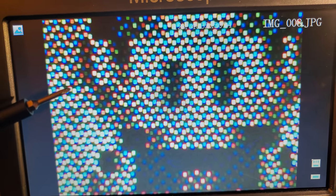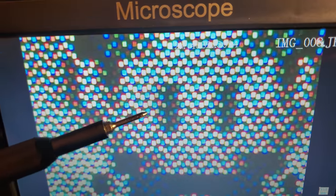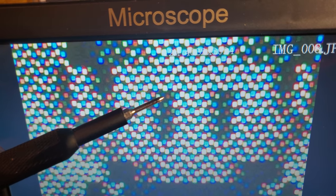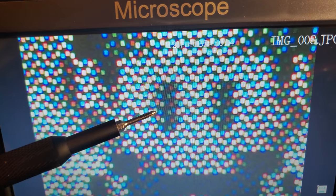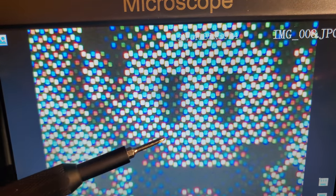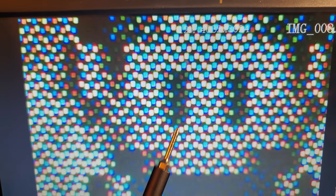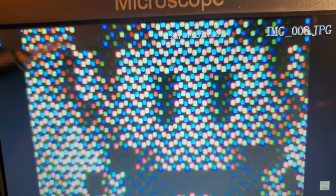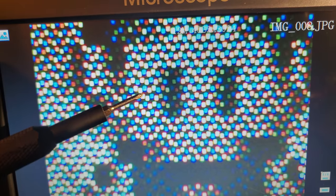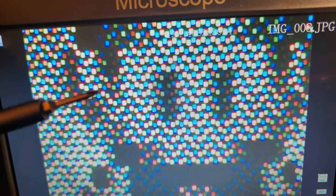the Revo, we've got something completely different. This thing uses a completely different sub-pixel grid array. I don't know how to interpret it. It's not quite the same. You can see we have 1, 1.5, 2.5, 3.5, 5, 6 making up his eye. Like, it's weird. You can see the green and the blue subpixel are slightly on when they should be completely off. You see what I mean? It's not 1-to-1, or even 1-to-2 for that matter. It's somewhere in between, but because of the strange orientation of the subpixel array, it doesn't actually look that bad.